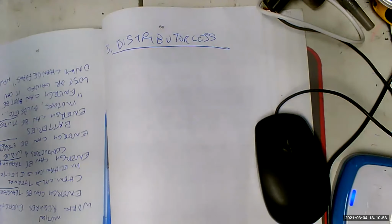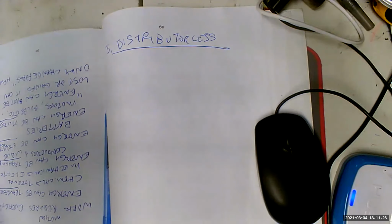Also, if you look at the insulators, the things that hold those wires onto the towers themselves, they're like 15 feet long. You would never think they were that long unless you actually looked at them. Why do you need a 15-foot-long insulator? Well, because it rains, right? And when it rains, everything gets more conductive, and those towers are going to be grounded. So when you've got 750,000 volts to ground, you probably want 15 feet worth of insulator.